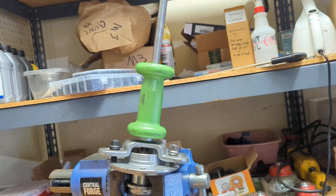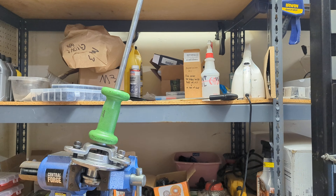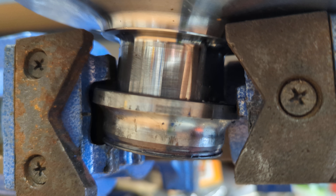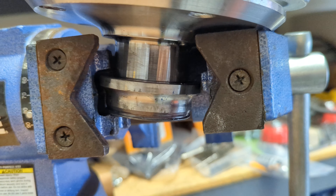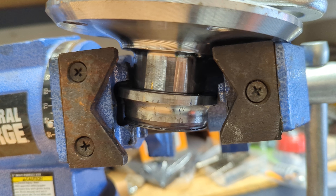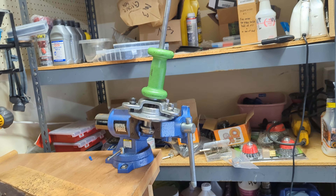I found this is working: stick this guy in a clamp and use a slide hammer to pop it out. Just make sure you get a good connection in here where the wheel bearing race is jammed in there pretty tightly. Good luck.